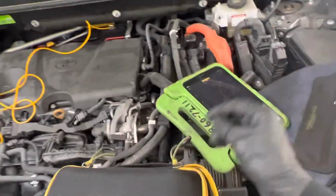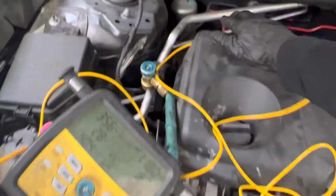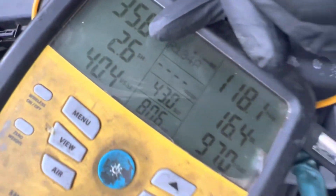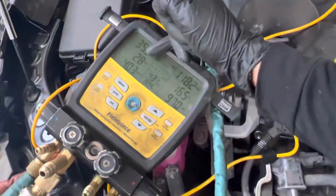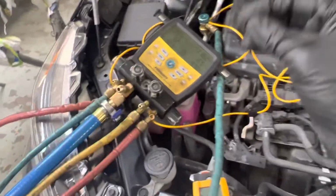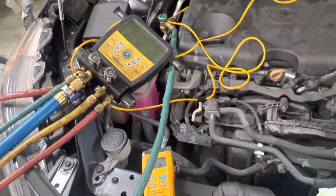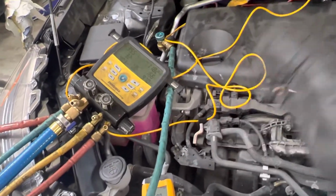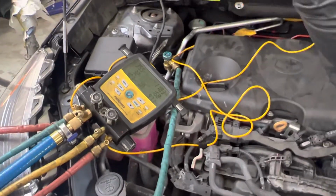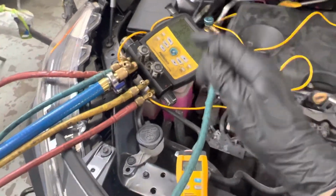Instead of being like one of the guys who just say they filled it up correctly, you can actually prove it. Because for you to get condensation on your line here, look where our superheat is. Now, some guys in refrigeration will say that's too low. Well, we're in automotive, we're not in refrigeration. We're not in residential split systems where you might want 15 degrees, or commercial refrigeration where you want 20, 30, 40 degrees, whatever equipment from whatever manufacturer and whatever type of refrigerant you're using.